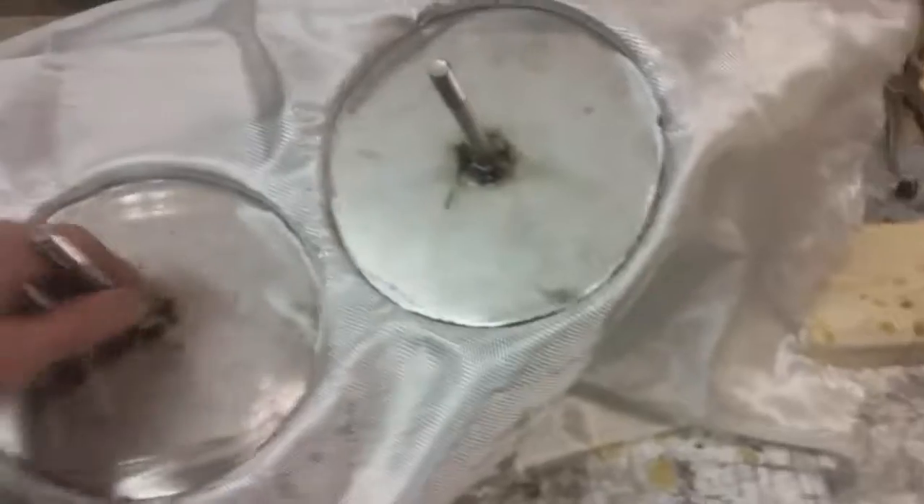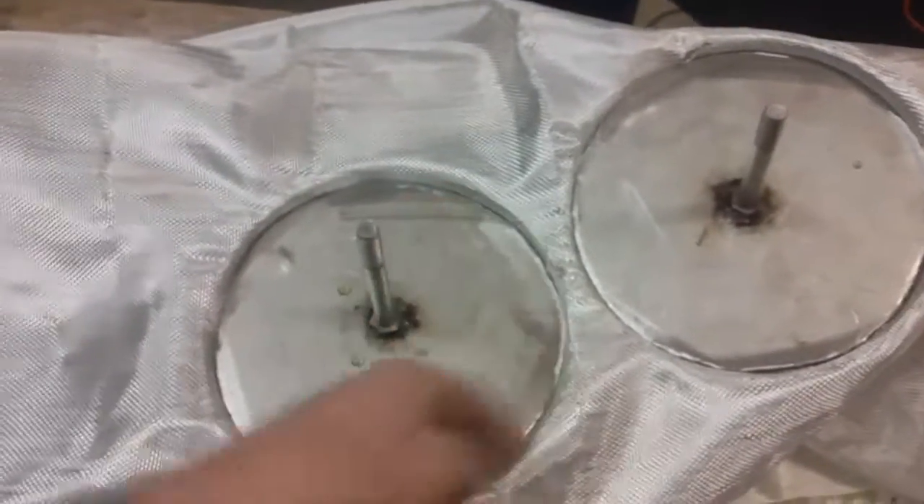Tomorrow I'm going to wrap the top of the fleece with the fiberglass matting — this will go over the top and give my fleece the strength it needs. I put the fleece on and I got these things that'll go in the speaker holes, so it holds the fiberglass in place while I stretch and fiberglass it. Then I'll pull these once I get the inner ring with resin, and I'll be able to push it down in there so it gets my lip.